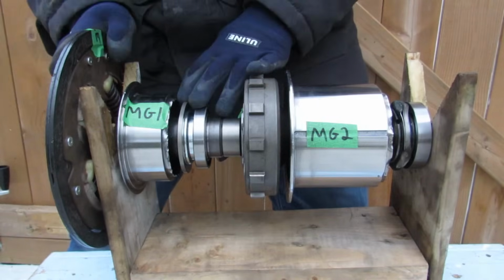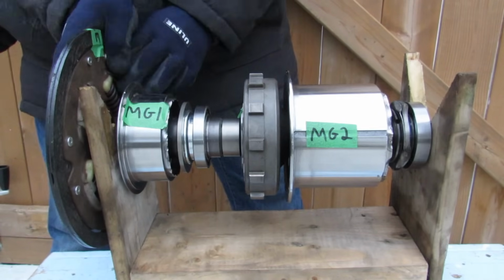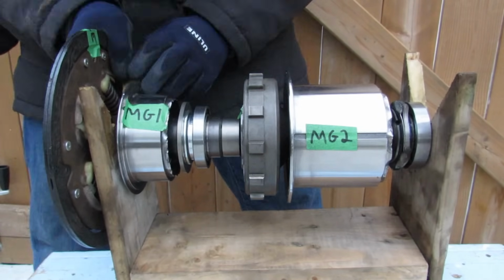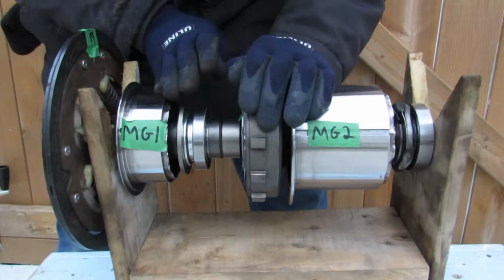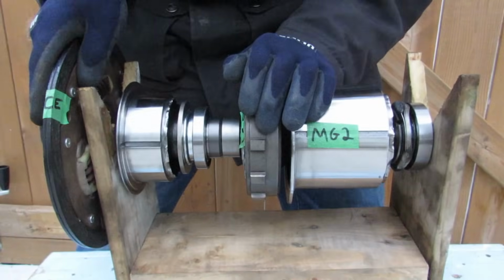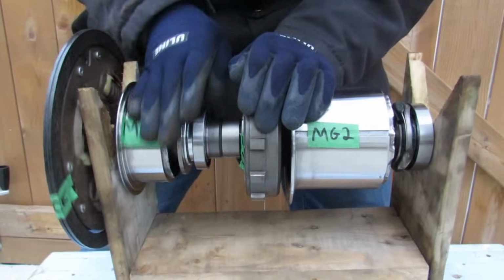Now, a lot of people wonder what happens when your battery can't take any more charge and needs to be replaced. Well, your vehicle's still going to work, but it's going to be quite jerky and very slow. You're still going to need a little bit of juice in there so that you can turn MG1 in order to start the engine, because the engine itself does not have a dedicated starter or an alternator, so that's going to have to start the engine.